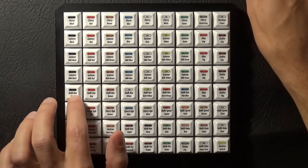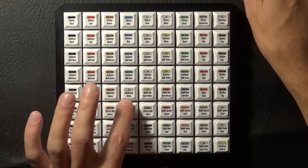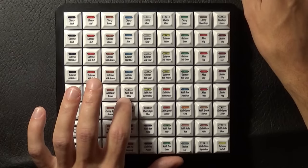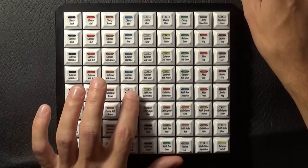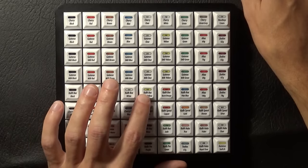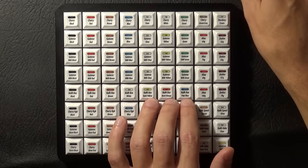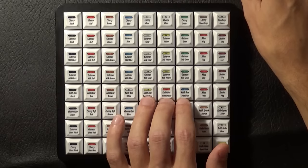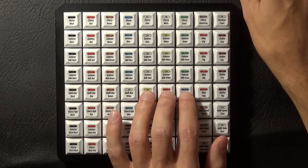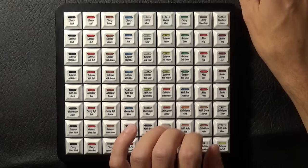First, it's the same colors as this one. The black one, the red one, the brown one. It's not a blue one, actually, because in the Kailh series it's actually the white one. That is the clicky one here. And then there are some special colors here: dark yellow, burnt orange, and pale blue. And these are in the Kailh Box Heavy series. So these are a bit heavier feel, heavier actuation force, that I will talk about later.